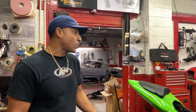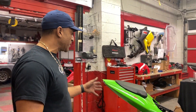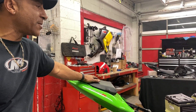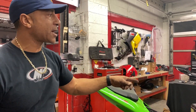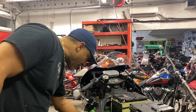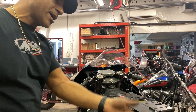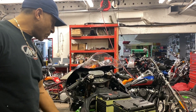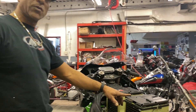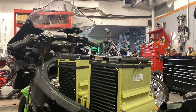We've made a lot of progress today and there's not too much more rough fabrication to do. We're going to make a wiring harness for the lighting system. I'm not using any of the existing Hayabusa wiring harness except from the switch housing to operate the horn, headlights, and turn signals. I'm just going to run straight out from the plug and run my own wiring harness for turn signals, a couple of flashers, and relays.